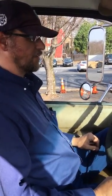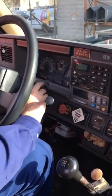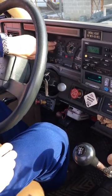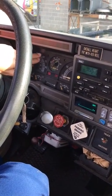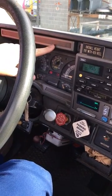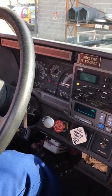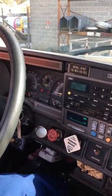The next part of the brake test is our low air pressure warning light and buzzer. First thing we're going to do is cut the switch on to the battery position, then fan the brakes. At around 60 PSI — notice there's a red line right there to help you remember — around 60, not at 60, we're going to see a light. As soon as that light comes on I'm going to stop fanning, because in this truck the buzzer comes on about two seconds later and I don't want to keep fanning or my brake will pop out.